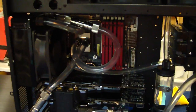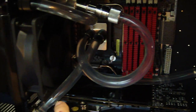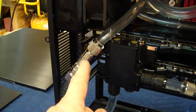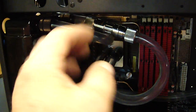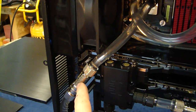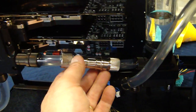I had a comment on one of the videos about why I didn't go from here to here in a straight shot — obviously this would be the connection you'd want to make, but this is too long. Same thing with this — why not just use a 90, pipe it straight up, another 90, pipe it straight over? Kink, kink, kink. The client didn't want any 90s; he wanted quick disconnects on the CPU block. By the way I arranged it, you only need three quick disconnects: one that goes up to the CPU, then the GPUs and the CPU share one, and then for draining the reservoir and disconnecting the GPU they share one. So it was an efficient way to make everything work out.